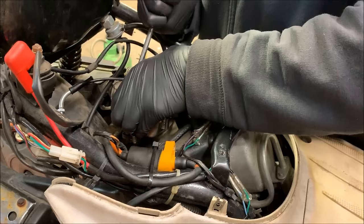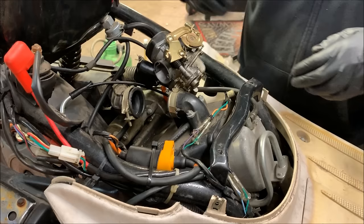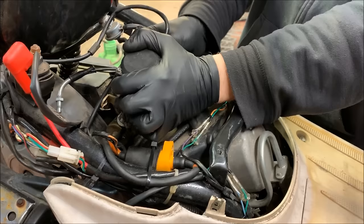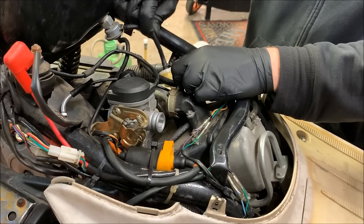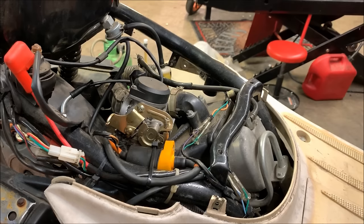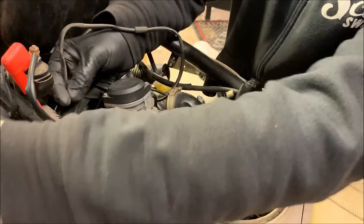What I like to do is get the air box hose sort of halfway off and then the carb can rotate out of the intake. Once you've loosened the carb, there's going to be your fuel line — pull your fuel line off. Some bikes that have been sitting a while will have the fuel tap stuck open, so use hemostats or something to pinch the fuel line. The other thing is the electronic choke — I'd rather leave that on there just in case you damage anything. Clip the OEM Chinese zip ties off and unplug your bi-starter so your carb's completely free.